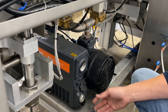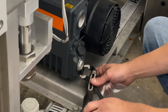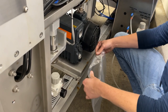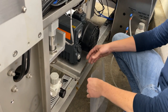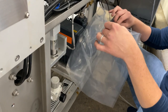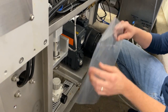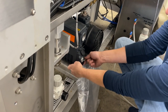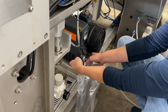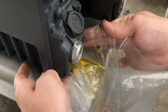In this case we're actually a little bit low on oil, so it's definitely a good time to be changing it. With your pair of pliers, adjustable wrench, or the correct size socket, you're just going to loosen up the drain plug. Now before you go too loose, get something under here. This machine doesn't work well with a traditional drain pan — that's why I recommend a bag. Vacuum bags work great because they hold hot liquids and are thick enough that you won't have leaks. Just cup it underneath and spin the plug off with your fingers. Make sure you don't let the plug drop in, then gently pull it out and hold it there so you don't make a mess.